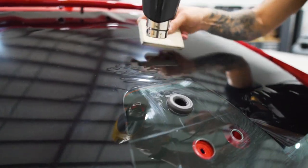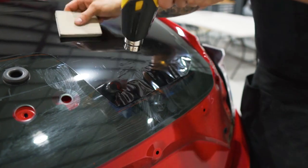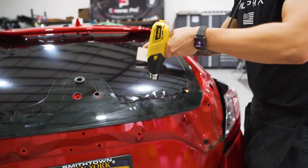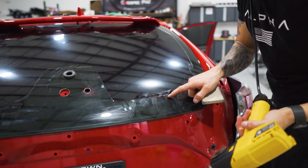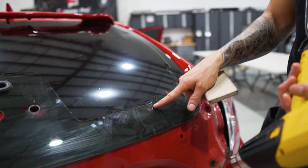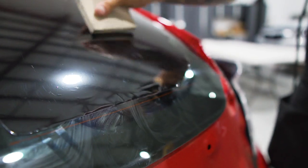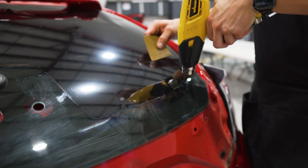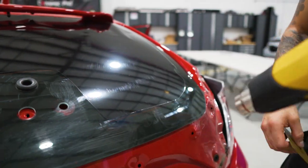Get the center shrunk. You can see right here the clear overheated a little bit and it causes that little pinch. What the clear will do — if you have excess clear like this with a pre-cut — it'll kind of crunch up and pull the remainder of the tint. So you want to stay at the top with the heat and push it right down. Use the gold card to get that to stick in place — heat, push, and that's it. Let's go to the other side and finish this off.